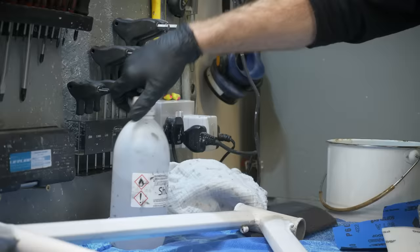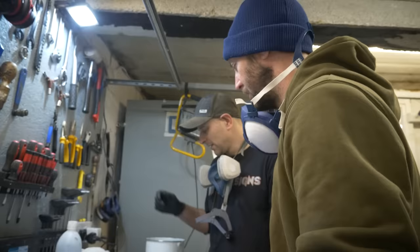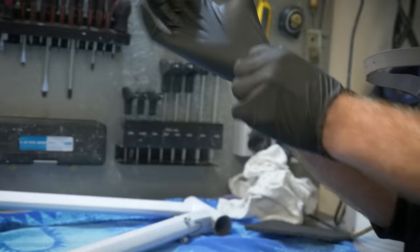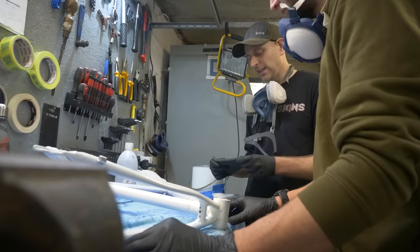So if we were doing it full-on at home — not sandblasting or anything like that — this is what we do first: a quick rub down with alcohol. Get all the dirt and grime off, get it clean. Always start clean — that's the main thing with painting, keeping everything clean. It's also important to wear gloves, not just to protect your hands but also to protect the frame from getting dirty. If you've got a frame in good condition, it really just needs a good going over with something like this — a scotch pad.